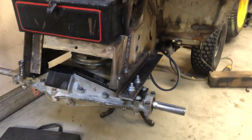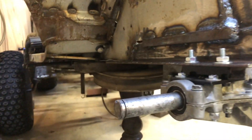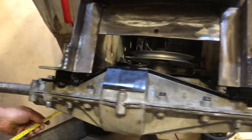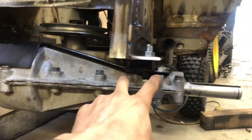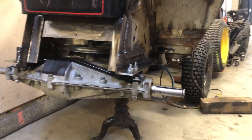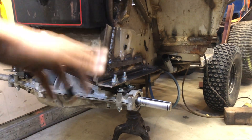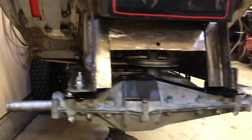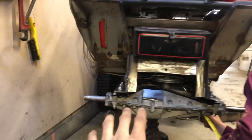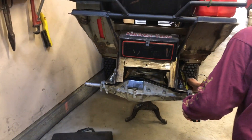This is looking unreal. You can see we had to do a three-quarter inch spacer drop there. We used M10 bolts up top here instead of three-eighths like I originally said, and we had a little bit of frame bracing so we got rid of that ugly cut line — we did that on both sides. This is a three-inch frame stretch and damn, that's unreal.